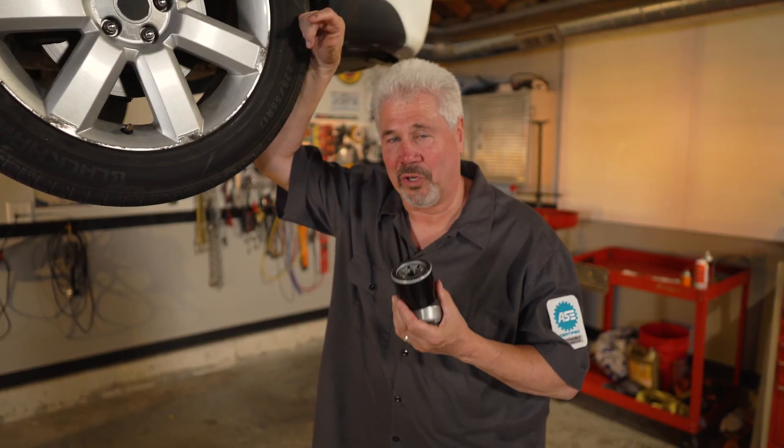Let's wrap it up. If you're installing an oil filter with a P-style seal, first make sure you have the right tool for the installation. And remember, this is critical: it needs to be torqued all the way to where the can touches the engine — this will prevent any future leaks. We appreciate your time, and thanks for watching.